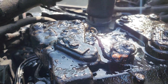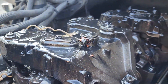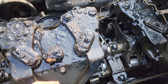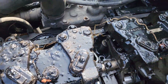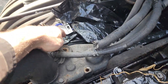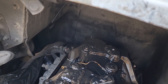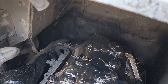You can see I have some nasty sludge built up on top of the jake brakes. This stuff needs to come out and be cleaned up. The jakes have to come off, wires have to come off, the rocker assembly needs to come up, I have to pull all six injectors, pull this assembly off, get to the back of the cylinder head and disconnect the 90-degree pressure check valve on the back — that's held on by a fuel line.